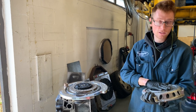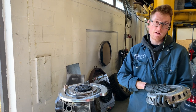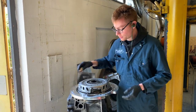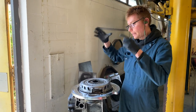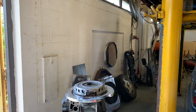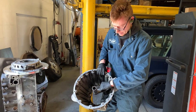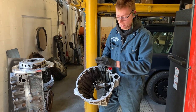That'll centre on the dowels that come in the flywheel — obviously that'll be all down and not loose. Then you'll have your cutout and it'll be a case of putting your dowels in or centering it on the spigot, depending on whether you're 200 or 300 TDI. Apply your gearbox and away you go. In some applications you do have to adjust the pivot point, which I'll show you. On some applications, if you're having problems with clutch engagement or it isn't clearing properly, this little pin inside here you can space out, screw it in or screw it out. But from memory, I don't think the Land Rover ones ever need that doing — I think you can just rock it straight out of the box with no issues.